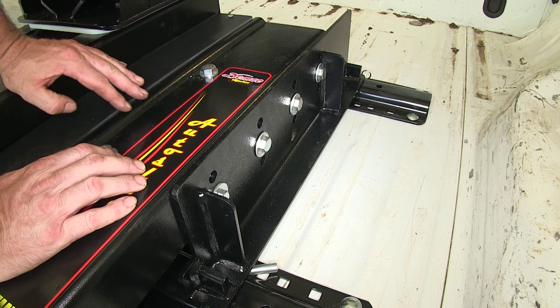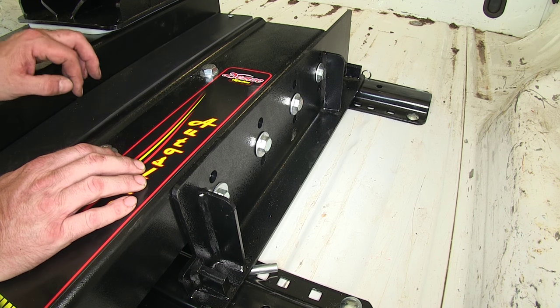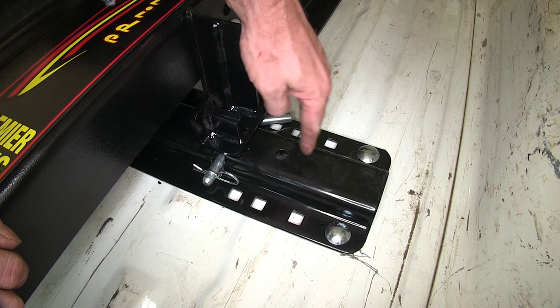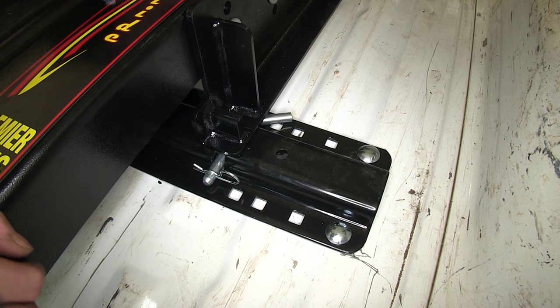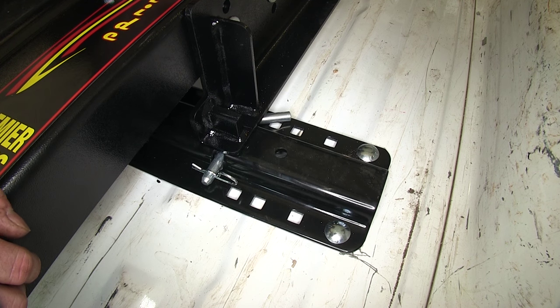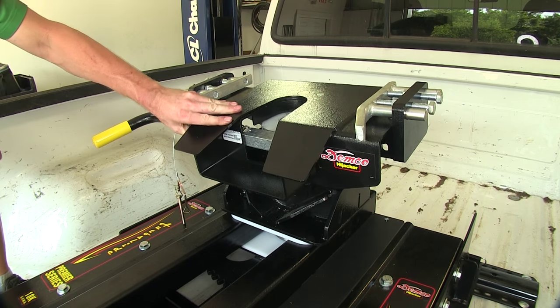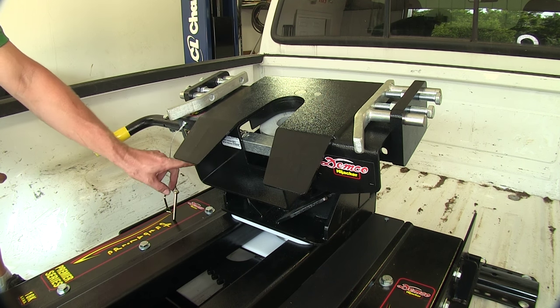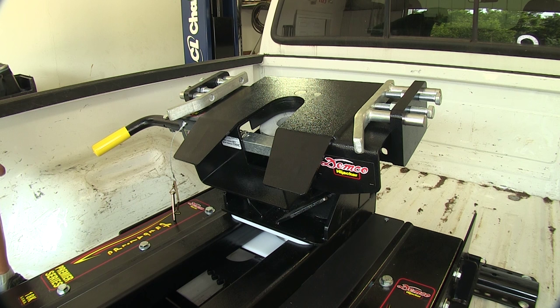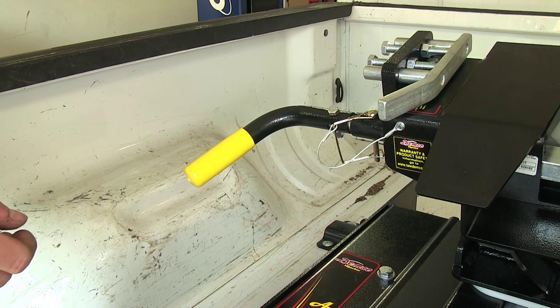This provides three levels of height to match up to your trailer. In this case, with the edge flush to the top, we have it in its highest position. You can see how the bracket interacts with the 5th wheel rails previously installed on the truck — it uses plain conventional pins and clips to hold it in place, and those do come included. The main part is the head assembly, with a pin that goes through the bottom using a clip on one side; you may need extra hands for that, but no tool is required. The last part is the handle, which gets bolted on using a 9/16 socket and wrench.